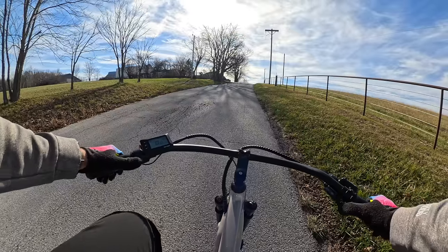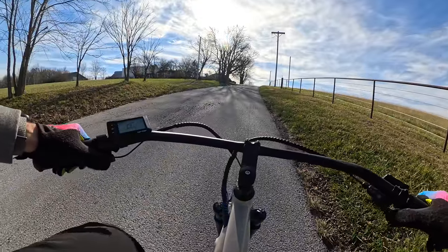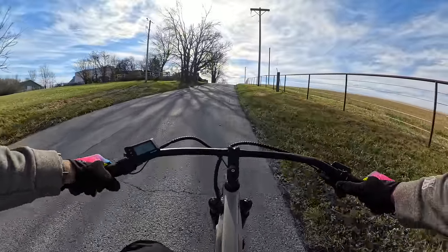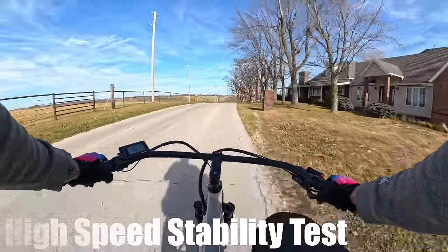Back on track now — don't let that discourage you from this bike at all, because that is just a derailleur adjustment. There's a high-low screw on there and the limiter on the high is just a little bit off. Getting going again on the 19% grade, I was able to start back up — which is pretty impressive.